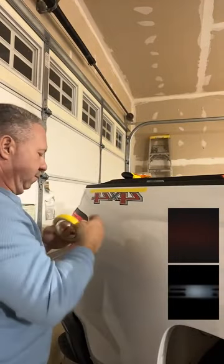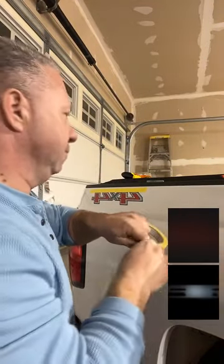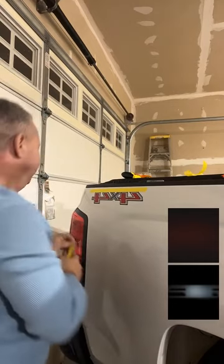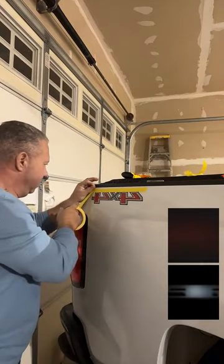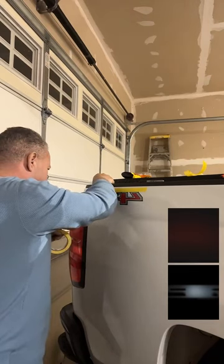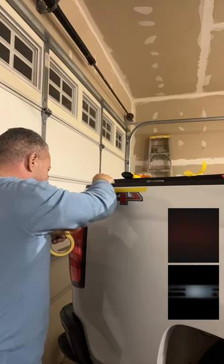One of the things that we would do is two things. One of them is you could use a touch-up applicator with a little bit of guide coat, if you have that, and we'll use that to do the marking. There's a couple of ways to do that. You use the pen. They actually make a marking pen for body work, which, believe it or not, is just a dry erase marker where the paint inside is thicker. It really is just a dry erase marker.